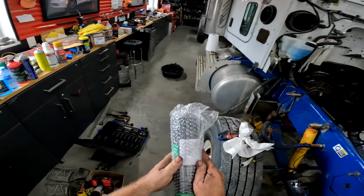My back ones don't. So I'm going to have to fart with this another day. I don't know if you can see that, but I'm about half an inch off, so I've got to pull the engine and transmission a half an inch back. I might even use a come-along, because now they're bolted together as a unit, so I could just grab onto the yoke on the back of the transmission and suck it up a bit. Oh, feels so good. So now start taking those parts and put back on here, which really isn't that much.